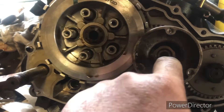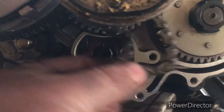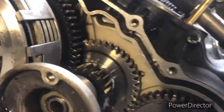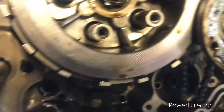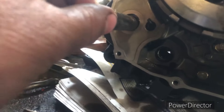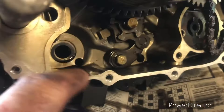The filters and the little oil filter — I'm super impressed by this little engine. There's a tiny balance shaft gear that is helically cut, really nicely made. The primary gear is beautifully made — a lovely little fine gear. There are quite a lot of gears in this engine. You can see the crankshaft, the primary drive gear, and the balance shaft gears, which all seem really good. The oil pump runs off a little chain. Also unusual — the kickstart shaft gear is not on the primary gear, which is a little unusual.